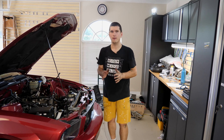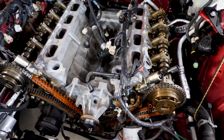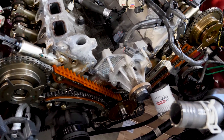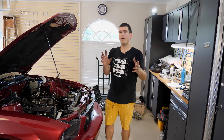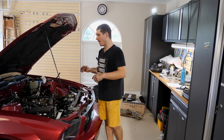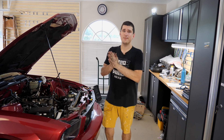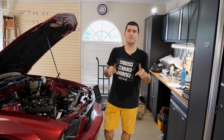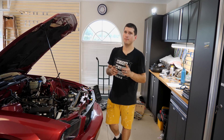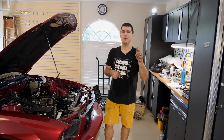Now that, my friends, is an absolute thing of beauty — I am so excited to be where we're at. We have the front cover off and everything is exposed. Now all that's left to do is make sure our timing is correct, then take off our tensioners, take off our guides, pull the chains off, and then we can finally remove our heads. However, that job is going to wait until Part 5. I want to spend considerable time making sure I let you all know how the timing works and how we make sure we get it right — because this is an interference motor, and if your timing is wrong it will be destroyed the next time you try to start it. Comment down below: are you tackling this alongside me, or just looking to get to one particular part? Definitely subscribe, like this video if you did, and I'll see you in the next one.